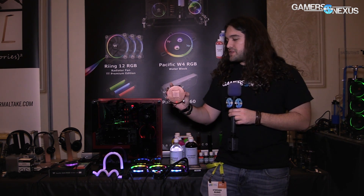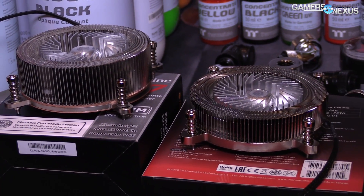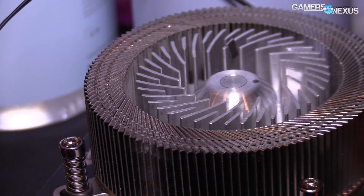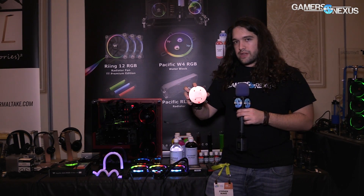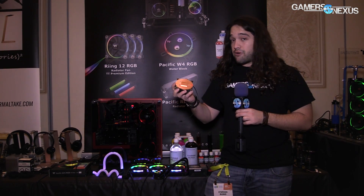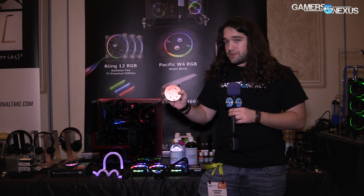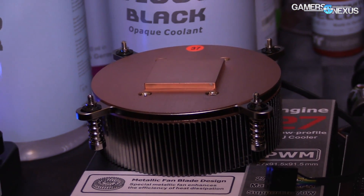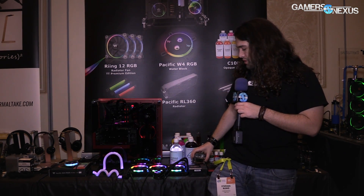At the bottom of this one there are two versions: one has an aluminum base plate or cold plate, and one has a copper cold plate. The one I have here is the copper cold plate, and if we look at the side it's got two layers of copper with a layer of what looks like aluminum in between. In this model I'm told there's a heat pipe inside the cold plate, but it's not confirmed if that will be final and make it to production. The plate itself that contacts the CPU is a protruded piece of copper, which we've generally found to perform at least a little bit better than a flat piece of copper.